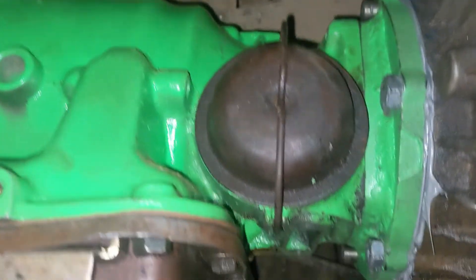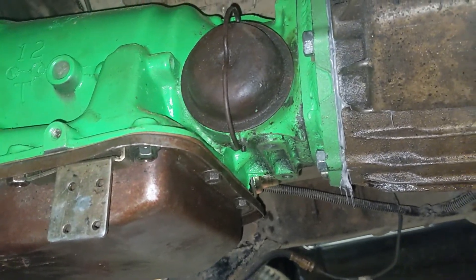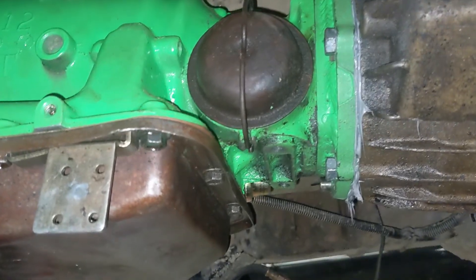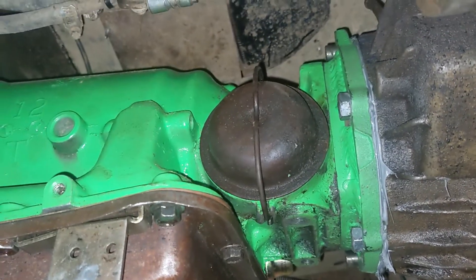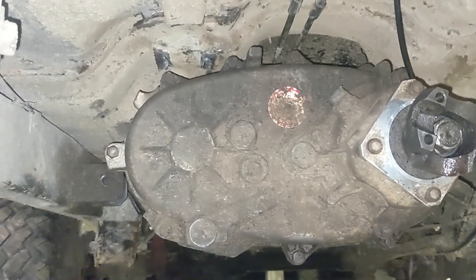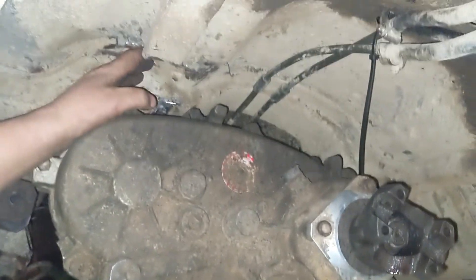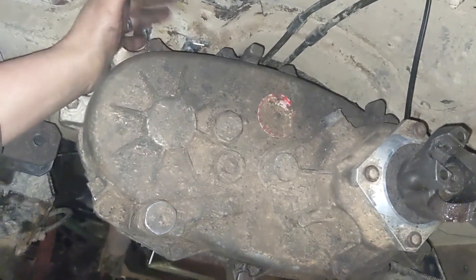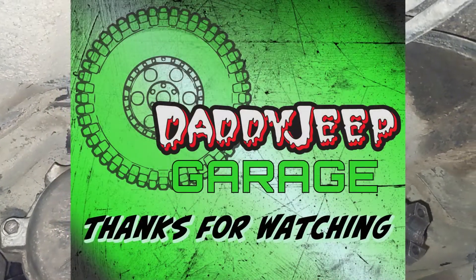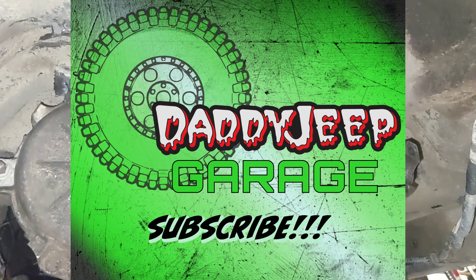The transfer case is installed. The new adapter is good — I've got all six bolts in there with a gasket and some high-torque RTV, which is gooping out all over the place, but that's all right. I do not want this to leak. I hope this new adapter solves my problem. With the new adapter we also adjusted the clocking of the transfer case and it is just about flat now. I did some clearancing up in here — I cut this cross member out to give it some room to move up. Once we get it back on the mount I sure hope that's going to be enough clearance, because I glued that thing in, so it better be okay.